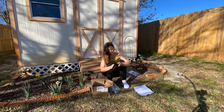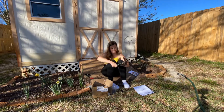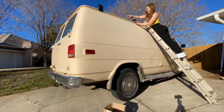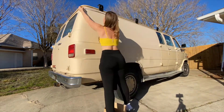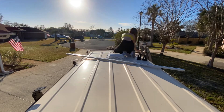I took these Smittybilt rain gutter clamps — I ordered a six-pack — and assembled them per factory instructions. Then it came time to put them onto my van. I measured and spaced them apart and loosely attached them. Don't freak out if when you go to attach the gutter clamps they are angled outward or inward — once you start attaching everything, they'll sit upright.